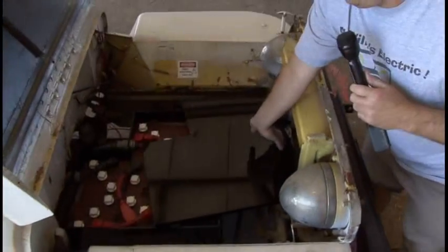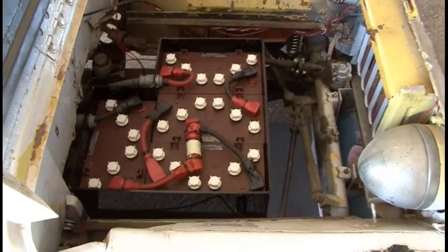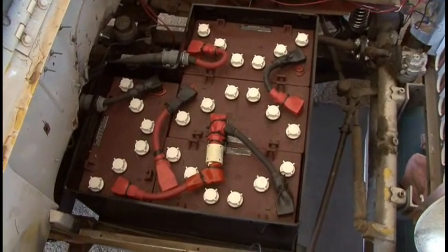It's a vehicle with about a 50-mile range. It'll do 70 miles an hour, and it has a 144-volt DC power system. We use it to teach a training class on how to build electric cars here in San Antonio. The vehicle has a total of 12 twelve-volt Trojan T1275 flooded lead-acid batteries.